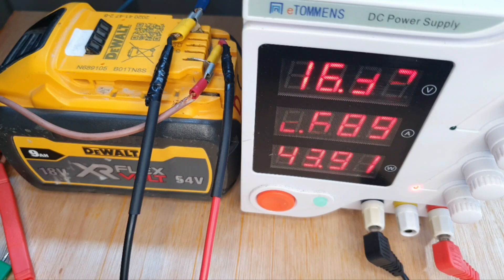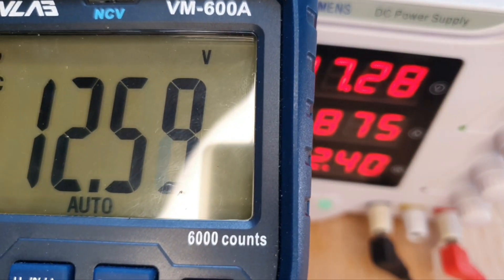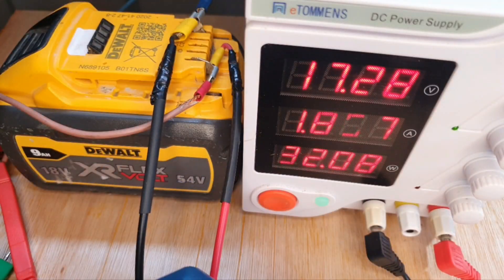This will take some time. To explain — this is a much safer way of bringing up the voltage of your battery, because using the jump start method is usually very effective but carries risks: although small, if things go wrong it can be catastrophic. I've also hooked up this multimeter to it and as you can see the voltage is coming up nicely.